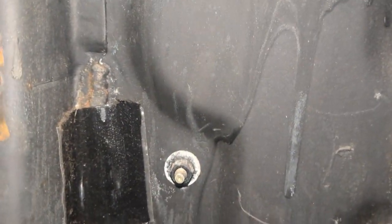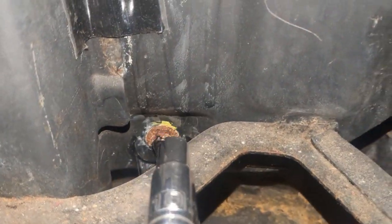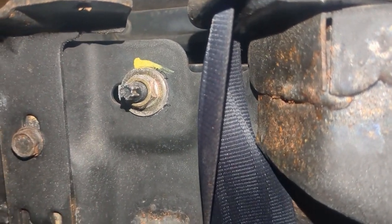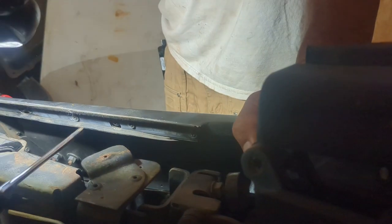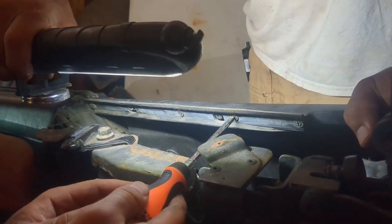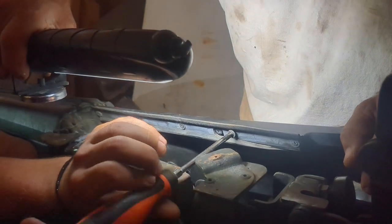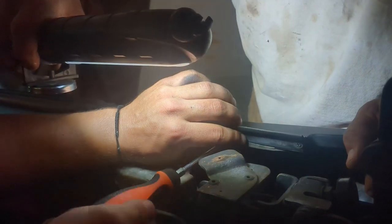It's a little out of order here, but those are the four screws that hold the window motor in, and down there's the first, second, and then third that hold the window tracks on. All of those gotta come off. If you're really good, you can remember how they're set to begin with, but I just took them off and then adjusted the window later. I also want to remove this piece of weather stripping from the top. It makes it easier to get the window in and out.